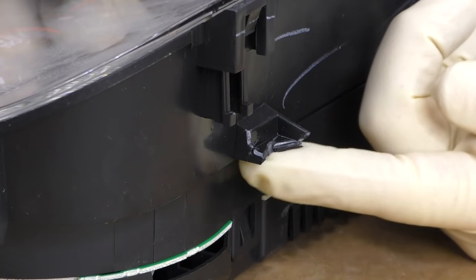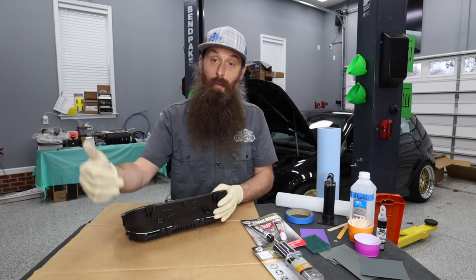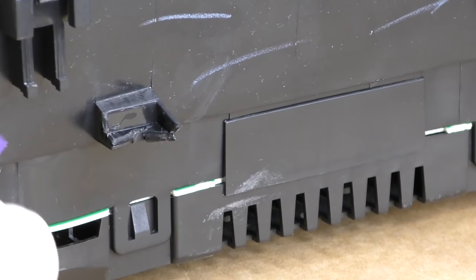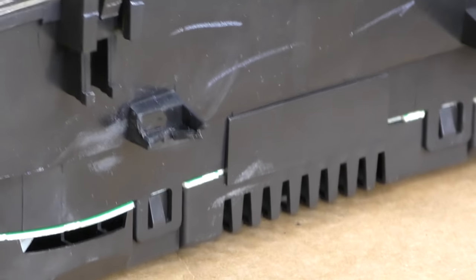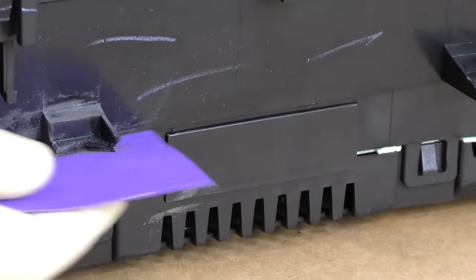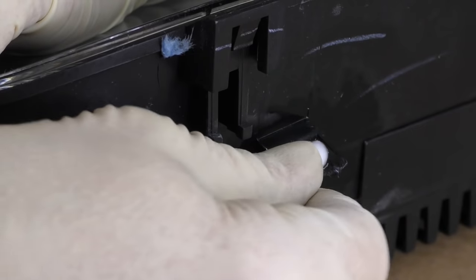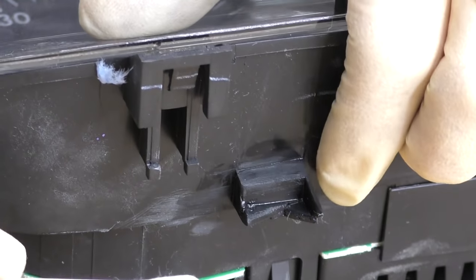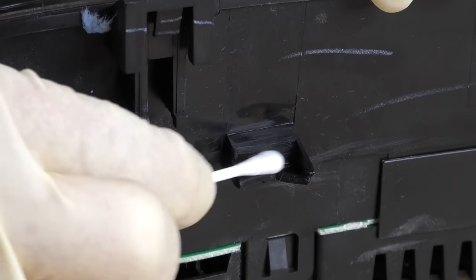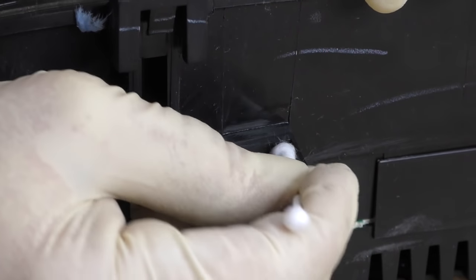You can see right here what the break on my instrument cluster looks like. This should have a screw hole in it, similar to this one here, and that's what actually holds the instrument cluster in place. Before we mess with the epoxy at all — don't even open it yet — we want to get our surface prepared. We're going to take some 180-grit sandpaper and scuff it up wherever we're going to end up with epoxy. This gives the epoxy more surface to adhere to and makes it less likely to peel off. Once that's well scuffed, it's time to clean it — take some rubbing alcohol and either a paper towel or some Q-tips and get as much dirt off as you can. If you're not sure whether it's clean enough, grab a clean Q-tip and rub where you've already cleaned; if you pull back a bunch of dirt, you've got to keep cleaning.